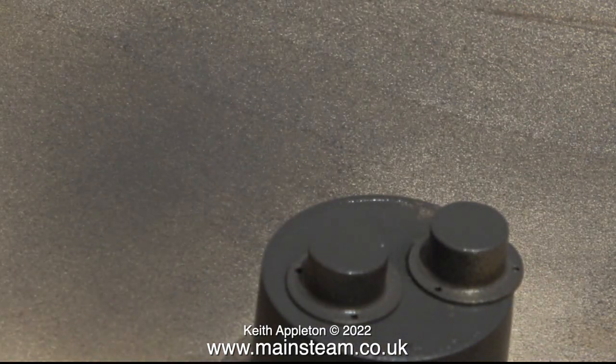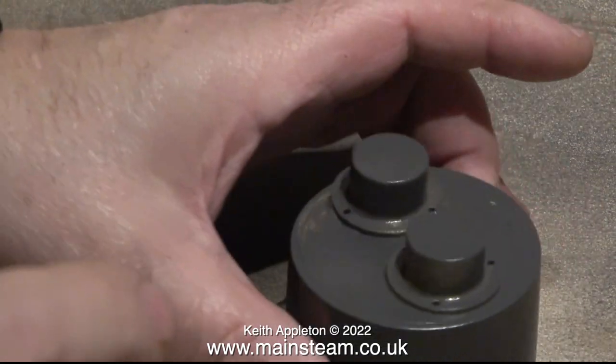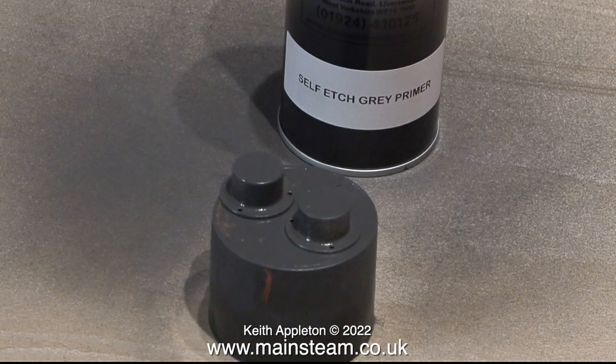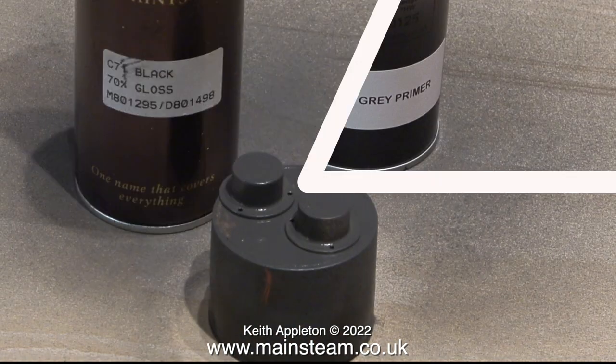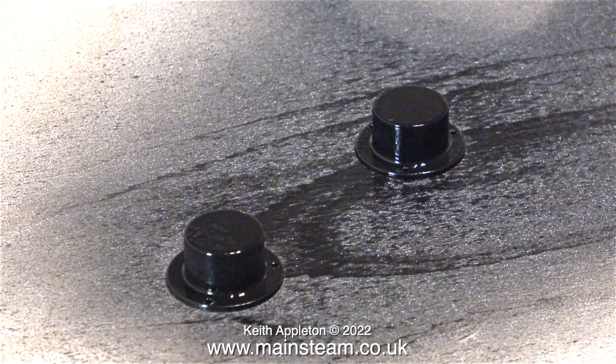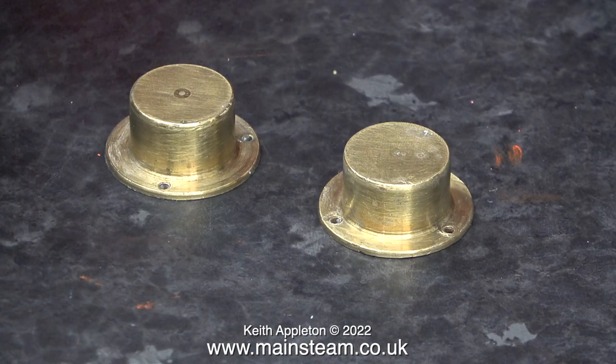After this, the job went a bit wrong. I have a can of gloss aerosol paint from HMG Paints and I thought that would be ideal for these parts. This is very good quality enamel paint, but I didn't get a good result. Look at the texture on the top of the hubcaps — it looks like Hammerite. The paint did not react with the etching primer; it just built up on top of the hubcaps and then bubbled, and it looked like it was the propellant from inside the can that was bubbling. Very odd.